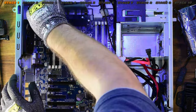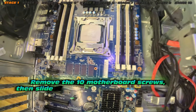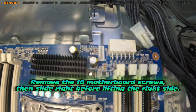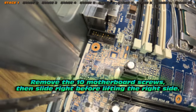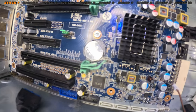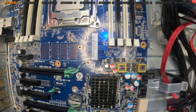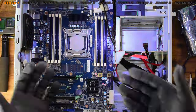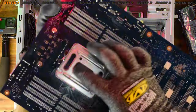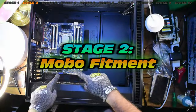Let's get all these motherboard screws removed and retrieve that motherboard — it's about 10 screws, very easy. Check out all the corners; there's quite a bit of hardware to get through. Once you've got these out, the motherboard lifts slightly to your right and then just lifts right out with a little bit of an angle. All screws removed, easy — and out it comes. There's our board ready for the Fractal Define — let's go!